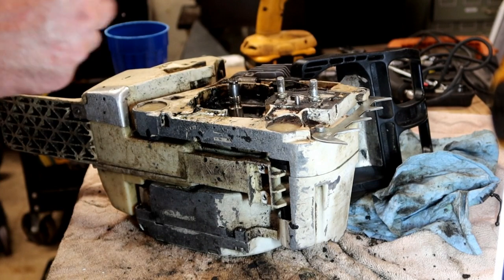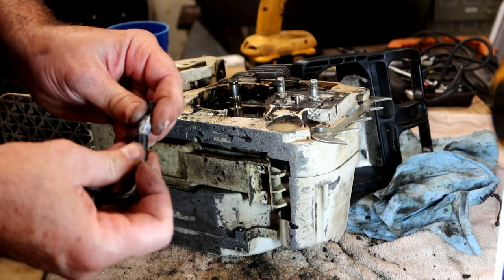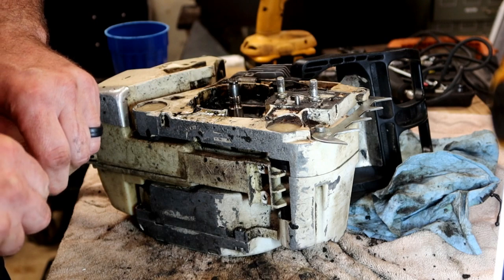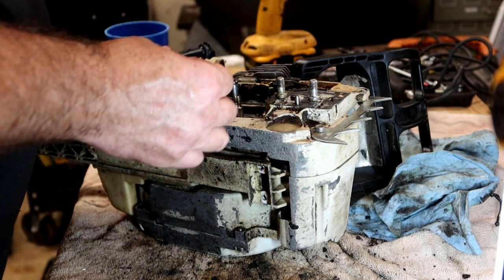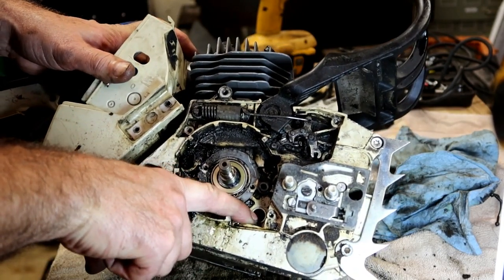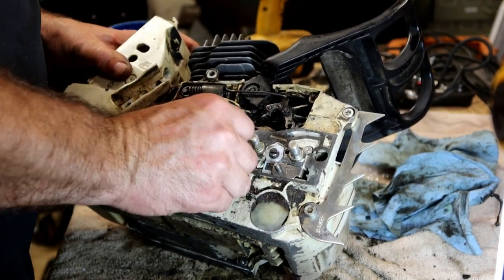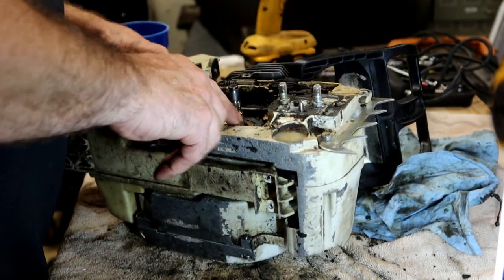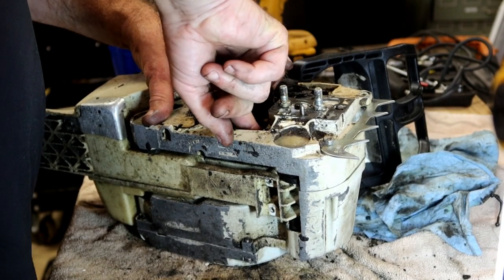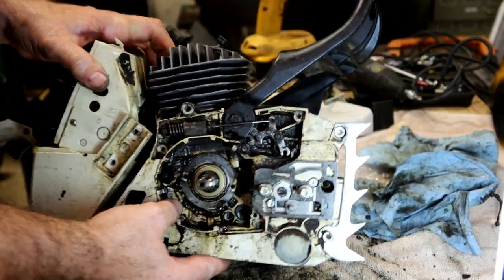I'm remembering that we had an oil leak, so the oil pump filter goes on like that. And there was a groove that makes this face straight down, right into that groove down there. So basically it sits in there like that. Drop it through. And just basically work that grommet until it seats in place. When it's done, it should look something like that.